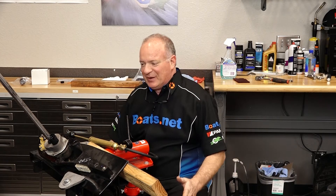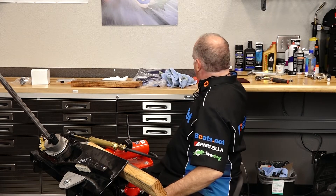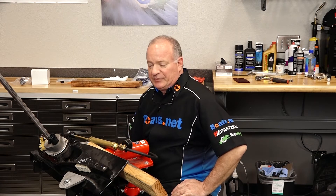This is a really short video, but now you know how to make sure that your lower unit is sealed up and ready to go. Now what would you do if it was losing pressure? Well, that's when you get some soapy water or some 409 — anything that's going to create bubbles — and spray it around your output shaft, input shaft, and your shift shaft. And that'll tell you which seals and or O-rings may need to be replaced on your unit.